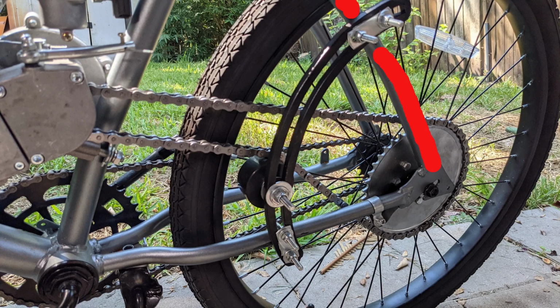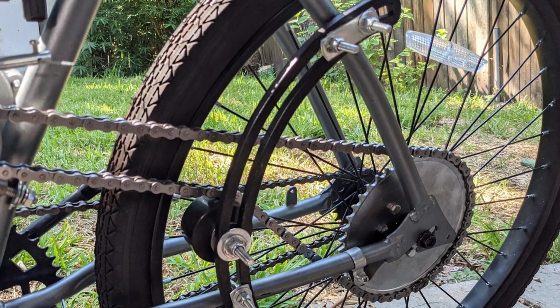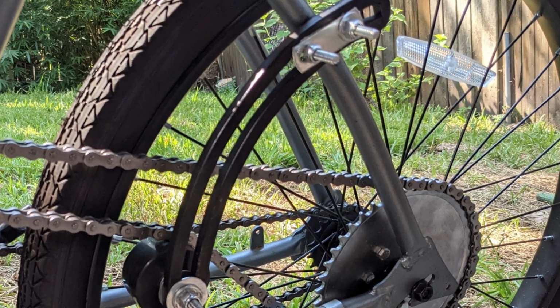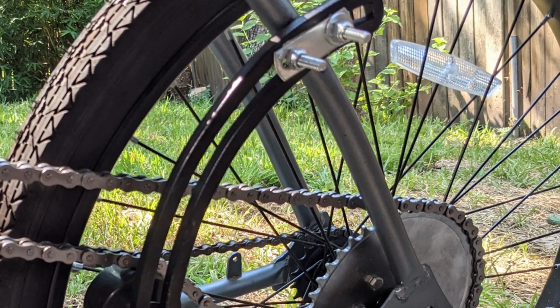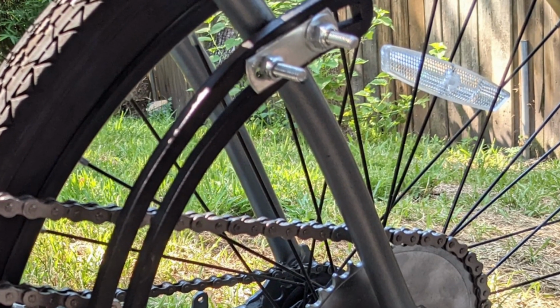So you put the U-bolts in from behind there, and you can see the two threaded parts of the U-bolt facing you there. We then put that through the arch tensioner. There is the plate that goes on, then you put a flat washer, then you put the nylock hex nut. You want to get everything secured and adjusted. Make sure that the curve and the arch corresponds to the wheel. Get that good and tight.